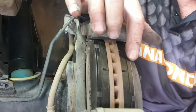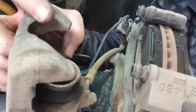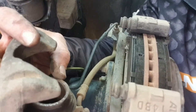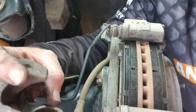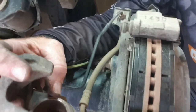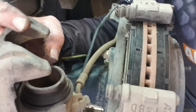That one has gone in, so both pads are in. There's a cylinder in here and you can see it just has to be pushed back in. What happens is as the brake pads wear down, this comes out and stays up against the back of the brake pad. When you put your foot on the brake it pushes into the pad — it only comes out a millimetre when your brakes aren't on. As you wear them down the cylinder keeps coming out, so to make it fit back in we just have to push it back in. Make sure the brake fluid doesn't overflow in the reservoir.